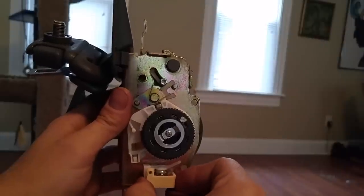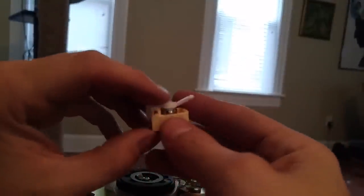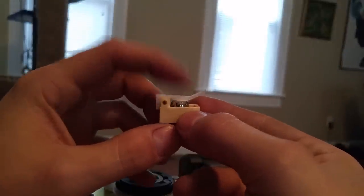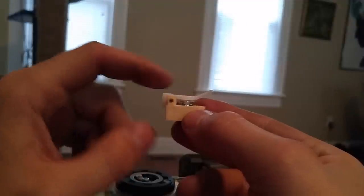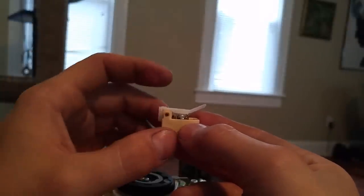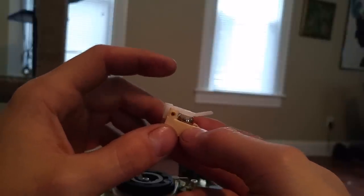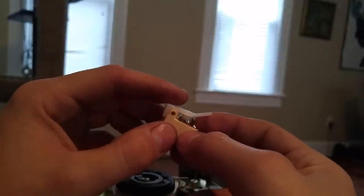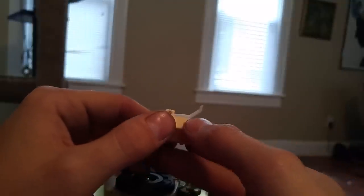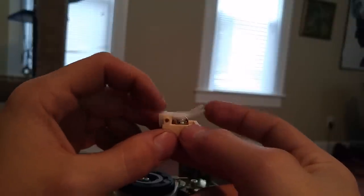We're going to take this piece and slide it forward. When the ball is totally sitting flat in its cup, the pawl is in the down position, meaning the belt will move up and down freely. But if you pitch forward — like someone hits you from the side — the pawl is going to go up when the momentum of this ball moves it outside of its seat. Same if you get rear-ended or have a frontal collision — that's what locks it.